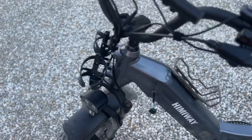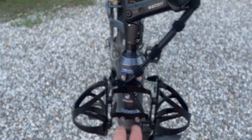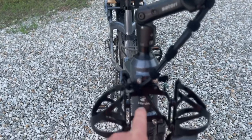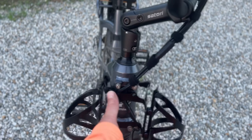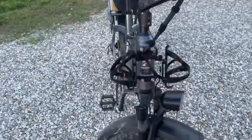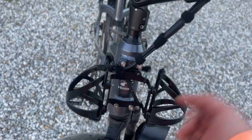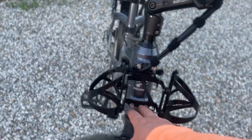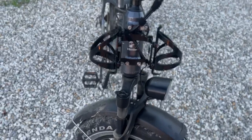You can get this bracket here and these bottle carriers that allow you to put them on the front basket. The Himiway Big Dog is different from the Escape and the Cruiser — the spacing on this is wider. That's why if you go to Himiway's website, the front basket they advertise does not say it is for the Big Dog, and I think that's because the spacing between the top screws and the bottom screws is different. Just recognize it's only going to mount on either the bottom or the top. I chose to put it on the bottom to lower the bottles further away from the handlebars.